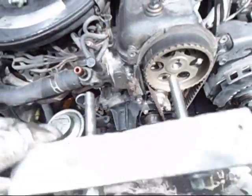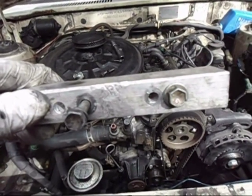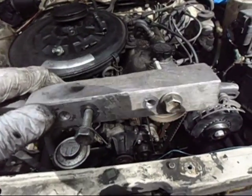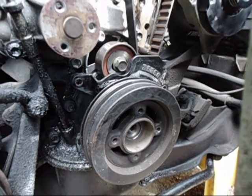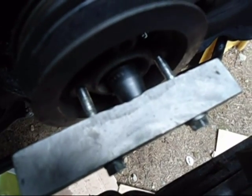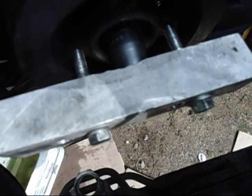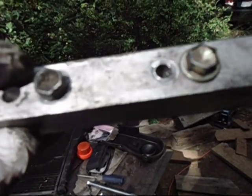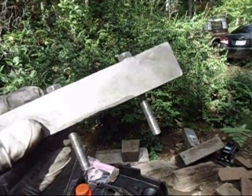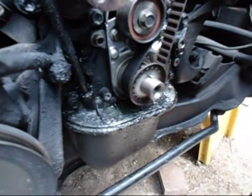The angle iron is about 36 inches long and made of 2x2x1/8 inch steel. Most of the time harmonic balancers just pull right off, but sometimes they're a little stuck. You take a piece of aluminum or steel, drill two holes — 5/16 inch diameter, 2-5/8 inches apart — and that'll screw into the two horizontal holes. Then put a spacer in between and a socket, tighten it down, and it pulls the balancer off. You can also drill another hole about two inches over to use the same tool to pop the steering wheel off.